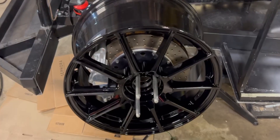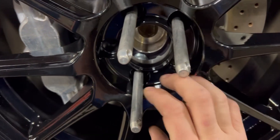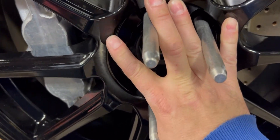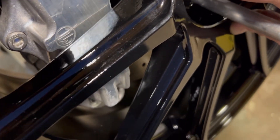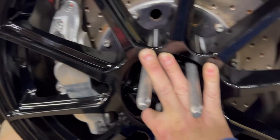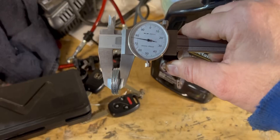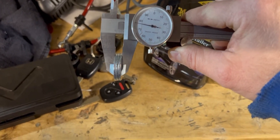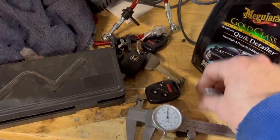I'm messing with the front wheels — I just put some washers in there so I could figure out how much distance I have. I can measure them to figure out what wheel spacer we need. That's about as tight as you can get it — pretty freaking close, a few millimeters in there. Measuring out about 0.276 inches, and I looked it up — that's about seven millimeters. So that's the minimum I can run.